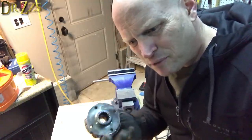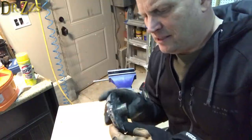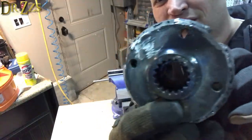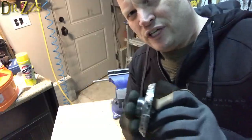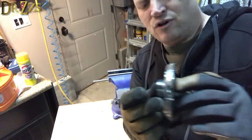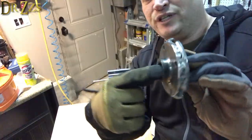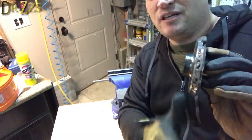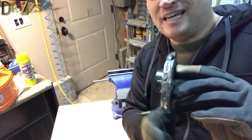On the shaft of the transmission now, I need to make sure that this won't slide. Because right now it only hangs on a very little bit. You can see how much of this I cut off. It only hangs on to the motor gear a very little bit, and it slides way down on the transmission shaft. So if I were to put it in there and put the motor in, if I didn't line up the teeth exactly and just pushed, this would just slide right off of the teeth on the motor shaft. So I need to make it stay.